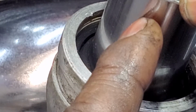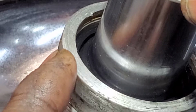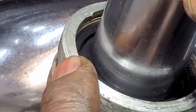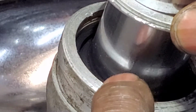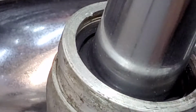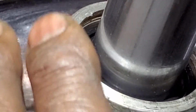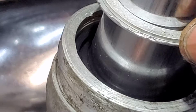So this part stays stationary and this part moves up and down with bumps and whatever as you ride. While you're doing that, the fork seal sometimes grabs this part and sometimes holds onto this part. So basically, it's got 4 millimeters of movement to sort of agitate itself within. If I put these spacers in here, that will absolutely ground that fork seal and make it stay set where it's supposed to and not allow it to move, and therefore the fork seal will remain sealed, which is, I think, probably the reason why the previous seals failed.